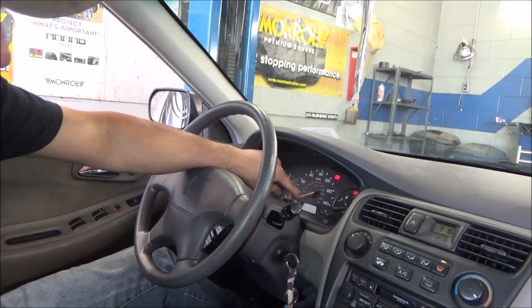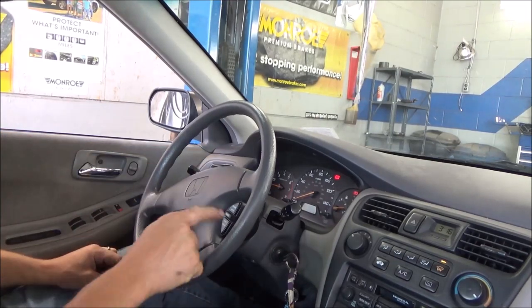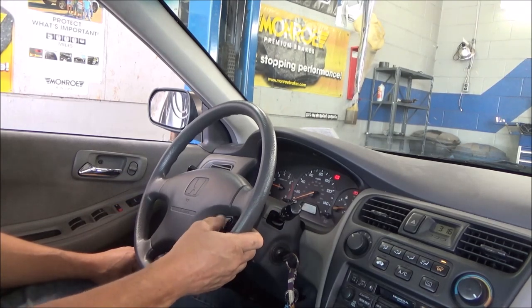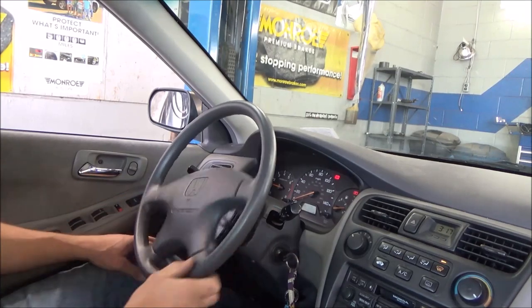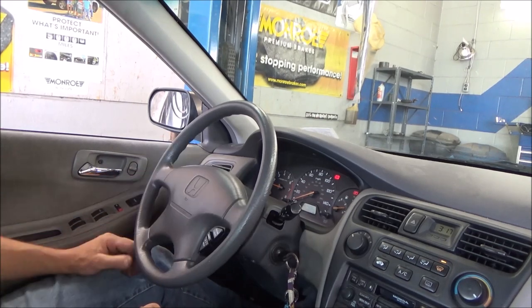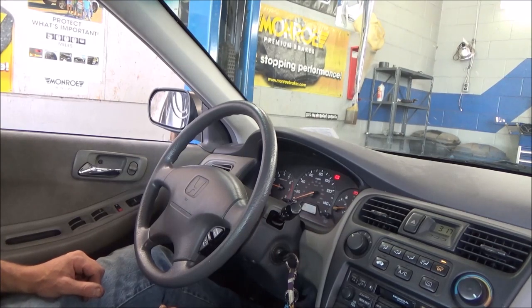So that's the airbag light up there — a little red one, probably hard to see in the video, but it says SRS. We've got no horn, and I'll just assume she's right. We've got no cruise control. Supposedly it happened all at the same time. I can see the cruise button over here doesn't light up. Typically you'd turn those on, push some buttons, and she'd maintain speed. First thing first, let's look at the horn — it's probably the simplest circuit to look at here.